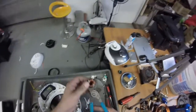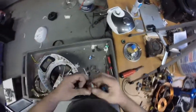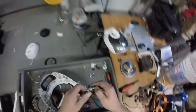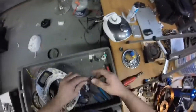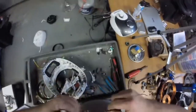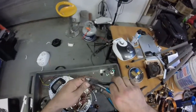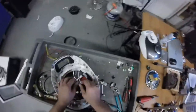Now it's broken in half. It's going to be a little difficult - I've got to break it in a couple more sections. I've got to get some real tools - I'm sick of these Chinese pliers. Excuse my language. Once you break it, it's really tightly wound but once you get it apart you can just do it like this - get the pieces of iron out. And once you've got it started you can really pull it apart. When I first started scrapping I used to unwind these and it would take about 10 minutes. Now it's literally about a minute to scrap them out. There's some copper wire right there. I'll do this one off camera - I just wanted to show you an example of how to scrap those pretty quickly.